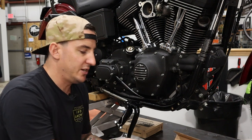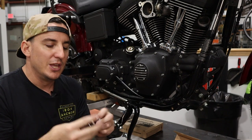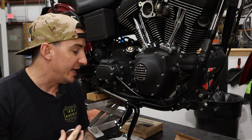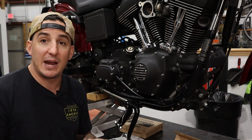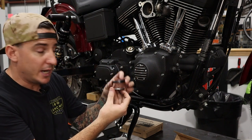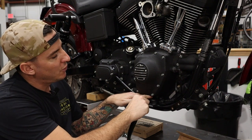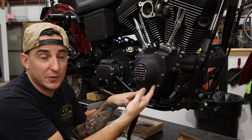Basically, it also comes in the box here. There are some shims. Now these are silver, obviously just regular metal colored. There are black ones. Tracker Die has not been immune to the supply chain problems, and they weren't able to get the black ones when we did this, but hopefully that'll be fixed soon. So if you order one, you might get these, you might get black ones, but they'll send you the black ones if you want. In any event, basically what you're trying to do is shim this puck up so that when it's sitting on top of here and sitting under your cam chest, you get between 1/4 inch and 3/8 inch of gap between the top of the puck and the bottom of the case or the cam chest.